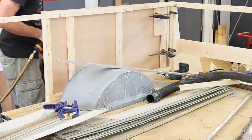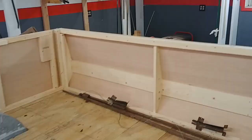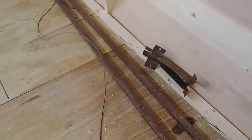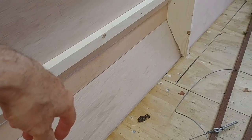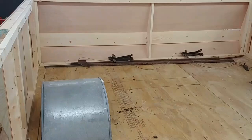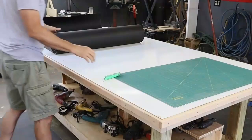This trailer didn't come with paneling on each end, but I decided to add it anyway. I didn't show it, but I just wanted to point it out — I think it's going to help keep each end a little bit more weather tight. When I last left you, I was talking about the toe boards. I determined through my pictures and videos that the back had a small toe board and the ones I put in were way too big, so I pulled them out and replaced them with a very small piece — looks like about one by two. As for the front, there was no toe board at all, so I was able to rearrange everything so it would not need a toe board in that area. Now giving you the view of the interior with all the framing done and all the paneling done.